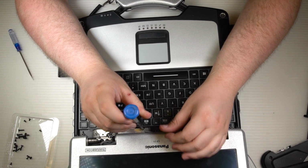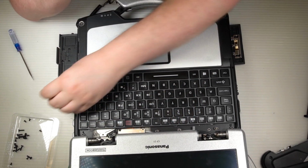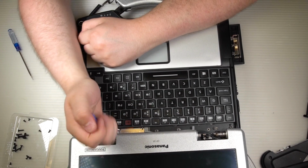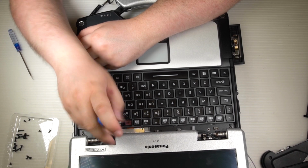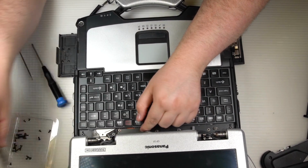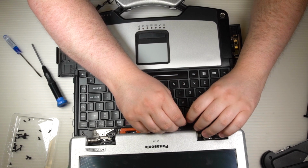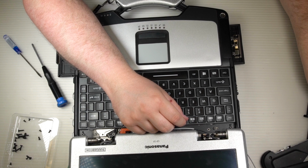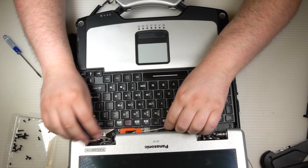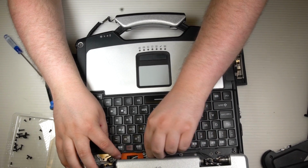And then open up your screen and there is a metal cover and plastic cover that cover the hole that leads to the bottom base that the antenna wires run underneath. It runs through that hole. Get those 2 screws out, holding it down, and lift them up so you can get the wires ready to run through the bottom and remove them. Once that's done, you can just get the antennas pulled up and get them ready to come out.